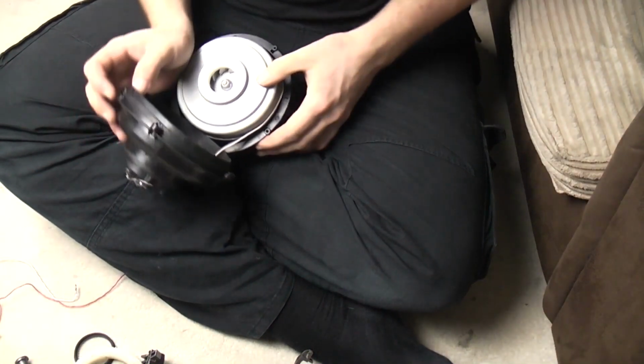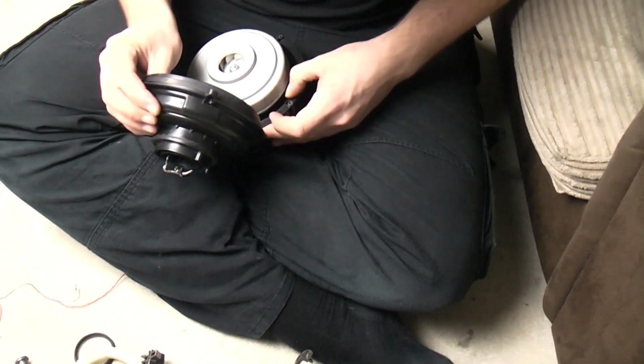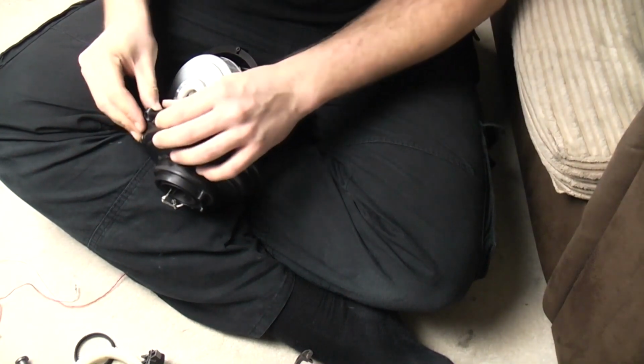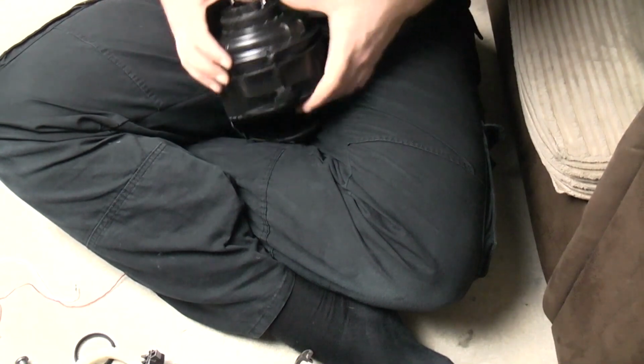And then I'm going to have to keep you at this angle because I can't move you now. Tuck the wires around under the fan case. Match up the kink in the top with the same kink that's in the bottom. Make sure that the motor housing seal is still in place.